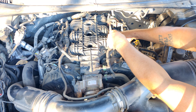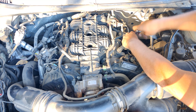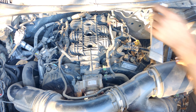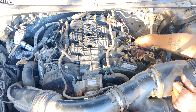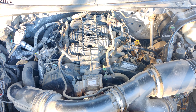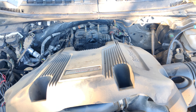Moving on to the driver's side - let's see what this first one looks like, see how rough it is. Most of them they just look like they've had a lot of hours on them. Even though none of them are cracked like the 2012 3.5 EcoBoost that I have - every 40,000 miles that thing will just be spiderwebbed with cracks in the porcelain. This motor does better. It's in pretty good shape other than just the wear at the end. We'll mark it and check in 40,000 miles to see if they actually need to be done.